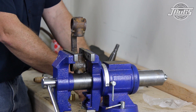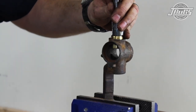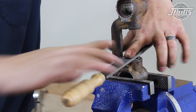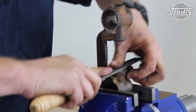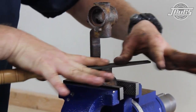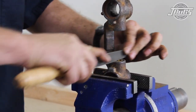The cleaned up spindle carrier is clamped back in the bench vise vertically with the bottom side up, and a new king pin bushing is dropped into place. The bushing is tapped into place using the same extension and socket used to remove the old bushings, tapped through the carrier and just slightly past the bottom edge. The spindle carrier is flipped over and a flat file is used to file the bushing flat with the carrier — do not file down the steel carrier; once you see marks into the carrier, stop. The top bushing is dropped in and installed in the same manner, then the spindle is flipped again and a flat file is used to file it flat, and the narrow end of the flat file is used to notch the bushing to match the carrier.